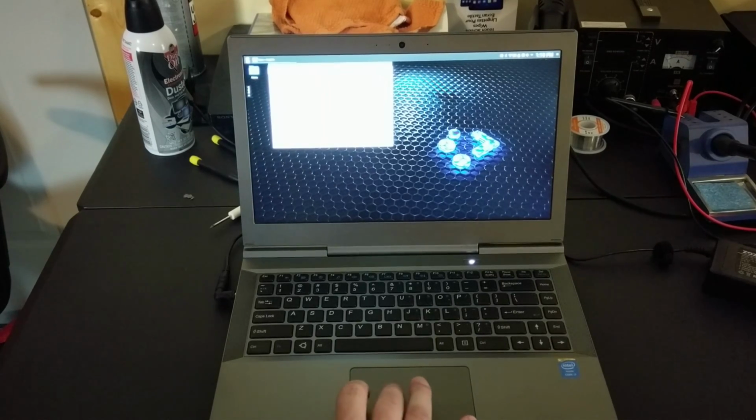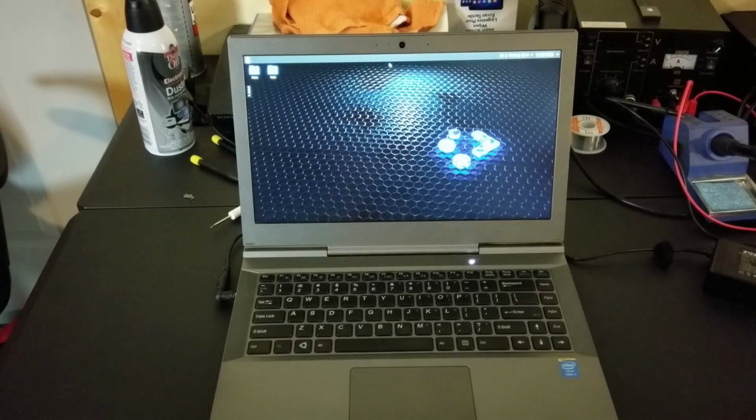So it does show up as the 200 gigabyte hard drive, and looks like it was a Linux partition there. So we could have, if the boot order wasn't set correctly, ended up booting into that other hard drive potentially. But I'll probably just end up formatting that additional hard drive, but it shows up. Everything is working. Isn't this machine lovely and beautiful? Yes, it is. And we just gave it tons more power. We have 0.5 terabyte of storage on this now in total. We have an SSD, a spinning drive as a backup.